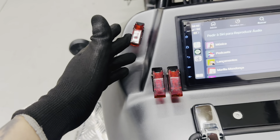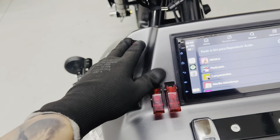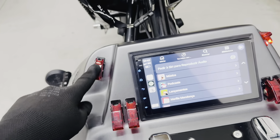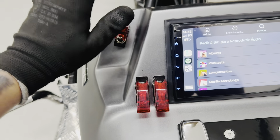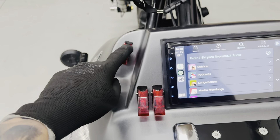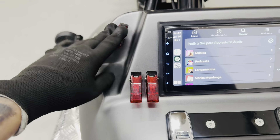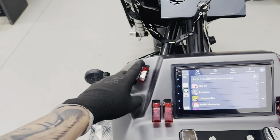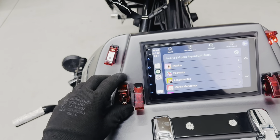This spare key — when there's nothing connected to it, like on a unit without a siren, to keep a clean look, I'll send it as a spare, just like on mine. It has nothing connected but it is energized, and the wires are under the seat. So you can later connect a strobe, an LED, or anything else — there's already an energized key switch ready so the setup looks clean.